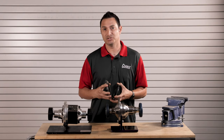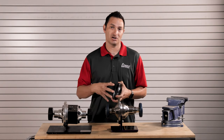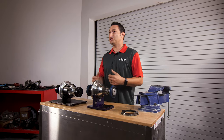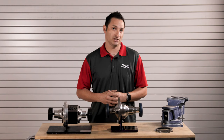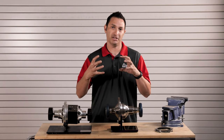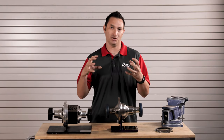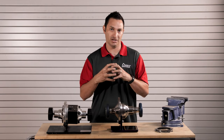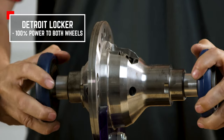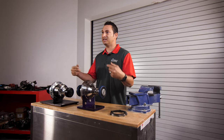You might need to drive the vehicle, maybe do a couple of figure eights — I'm sure you've heard that before — in order for the gear lube to work its way back into the clutches for this to work properly. You've also heard of a locker type of rear-end, Detroit Locker being one of the most popular. The Detroit Locker basically is two plates that are spring-loaded, and those teeth pull away from each other and push against each other.